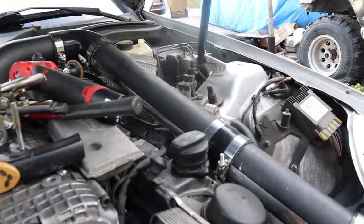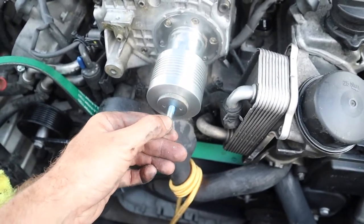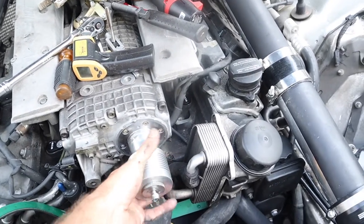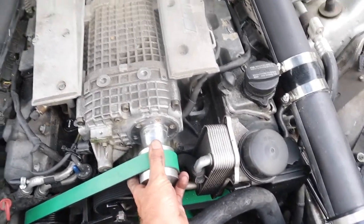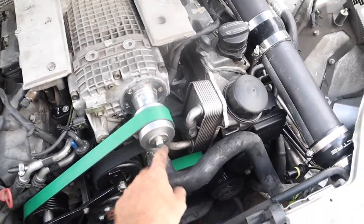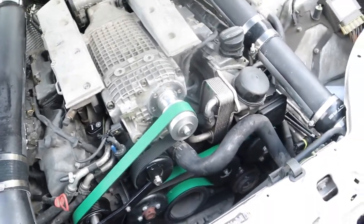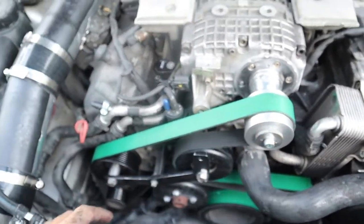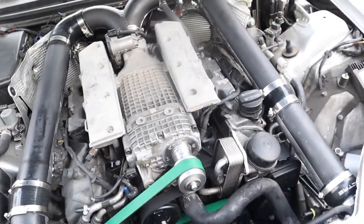It was about to storm really bad out here. I'm going to go get the bolt that came with it, put some Loctite on, and keep going. I threw some blue Loctite on there and we're going to start threading it in — goes in pretty good. I'm going to put the camera down because I do have to brace this, then I'll look up the torque specs and torque it. Got it all back on — that is looking pretty, pretty sweet. I'm going to re-torque it one more time now that it's braced. The pulley saver kit I got from Needs Wings — I think it's going to help out so much. I told them what size pulley and I'm pretty sure I could even go smaller and this kit will still work, though I may need a different belt. So far I got a 65mm.